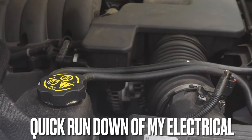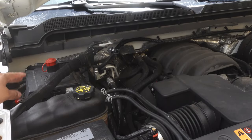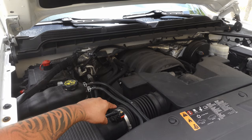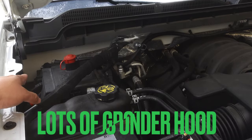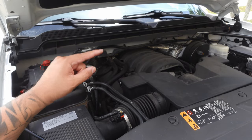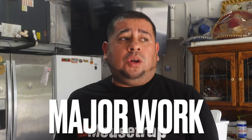I am still on my factory alternator, but I actually have the big three upgraded on it. I do have a power wire ran from the battery to the alternator, a wire from the ground running to the alternator, the alternator ran to a frame ground, and the alternator ran to another body ground as well. I have the battery going down to the frame and then the battery going to a body ground. The only thing I feel I am lacking is a power and ground from the alternator running all the way to the back. I do have four baby batteries back there underneath all the panels and the stunt wall stuff that are doing some major work.